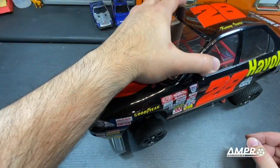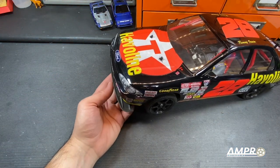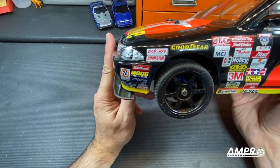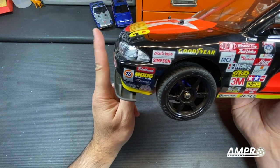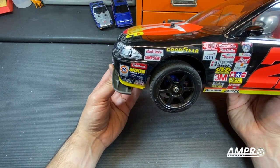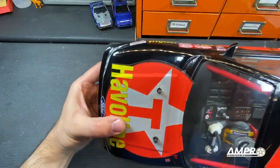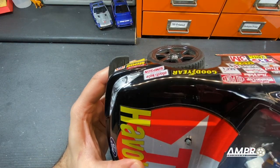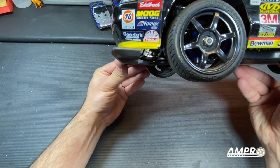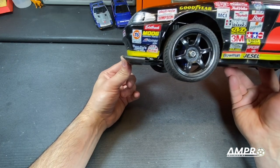Now the body can be installed. And for once in this car's history, I will finally not be worried about crashing it into something. Now, it's not like the bumper sticks out 10 feet. It is just about planar with the bumper. This is intended to not look horrible, number 1, and number 2, deflect any major impacts from the body. Minor impacts all should be good, and this is why it protrudes so much on the side here. The purpose of this bumper is to actually deflect impacts from the body, being as unobtrusive as possible. You can see that in profile, it should hit something and go over it, as opposed to what the existing bumper does, which just kind of hits it.